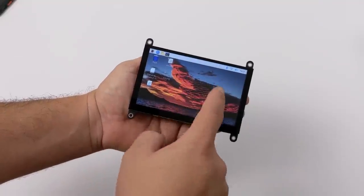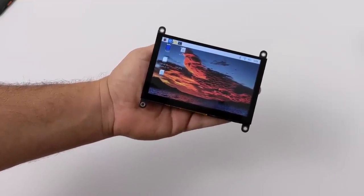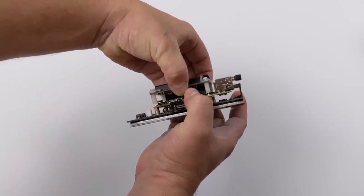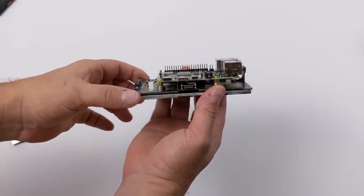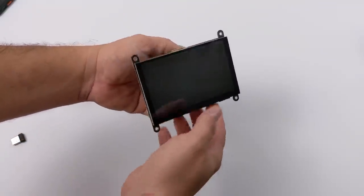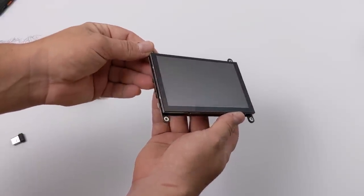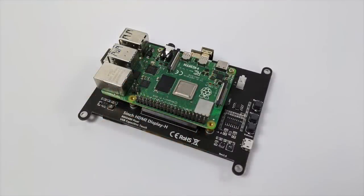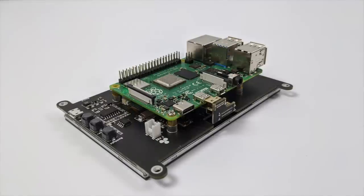Overall, I really do like the screen. The colors are a bit muted for my liking, but this is the best I've found for the project I want to use one of these for. We also have that built-in speaker, which is a big plus. Pretty much everything worked out of the box with Raspberry Pi OS except for sound, and all I had to do was switch it over in Raspi-config — not a big deal. I love the form factor and the fact that we don't have any wires sticking out. It connects over HDMI and USB, and that's all we really need. I picked mine up on Amazon for around $55. I'll leave a few links in the description, and keep an eye on the channel because now that I have the screen I'm going to be using, I'll have a handheld build up very soon. Thanks for watching!